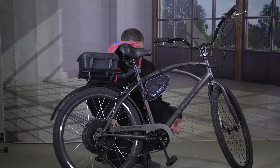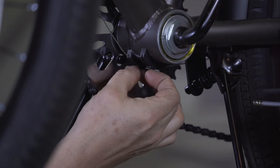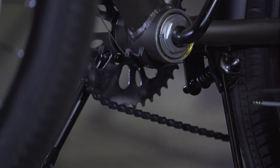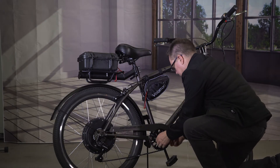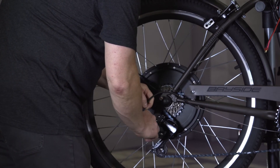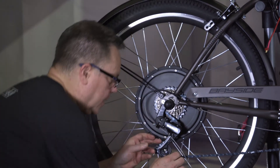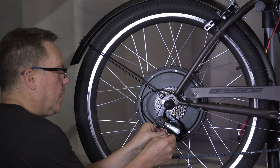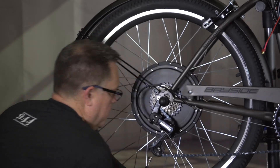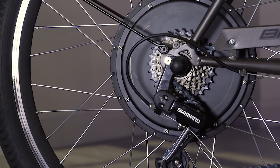On the bottom part, right underneath the crank, there's a little plastic piece with two channels and the cable slides into those channels. There's a little piece you have to push through so it won't pop out of the guide. Slide that right through there and that's going to get you back to the rear barrel — make sure you're on the outside one because we're going to this derailleur. We've got it lubed up and everything's in the bracket, and you can see that thing's moving back and forth the way it should.